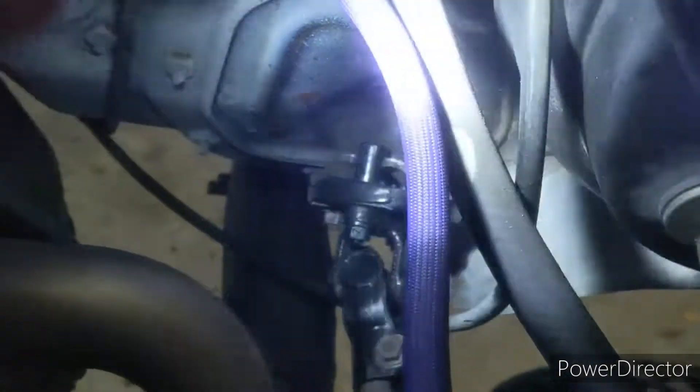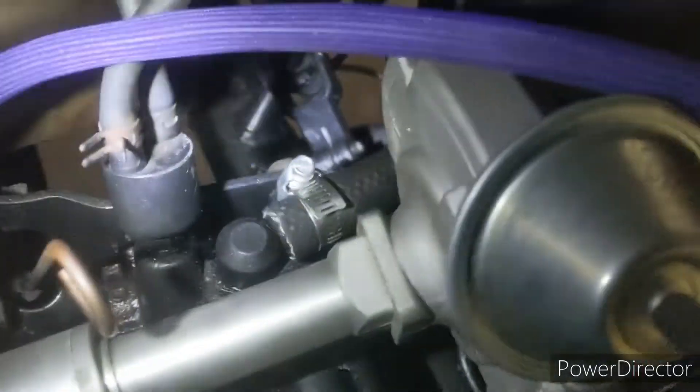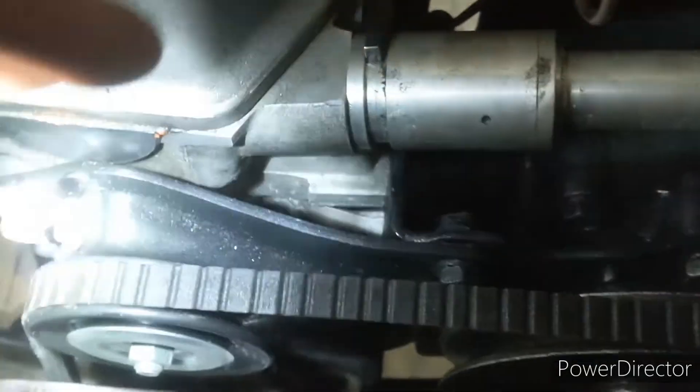The steering box area has a lot of plumbing going on, especially with this huge distributor — lots of stuff to route. I've got it routed how I want; still need to tuck and zip-tie everything. I used all the four-cylinder pump brackets, put a new Koyo idler bearing from the dealership, new belts, painted everything. All new hoses except for the high-pressure hose — it's a low-mileage four-cylinder. So it's the four-cylinder pump, brackets, pulleys, mini-truck hose, and four-cylinder reservoir plumbed into the Land Cruiser steering box. Everything just lined up — no adapters needed for any of the fittings. Stoked on that.